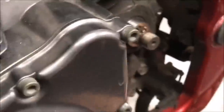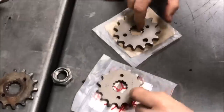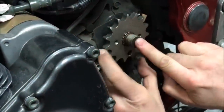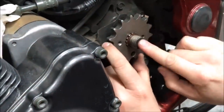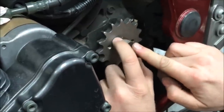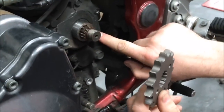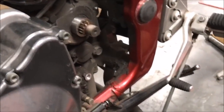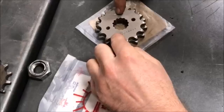Check this out - here are a couple of sprockets. They were debating on gearing, so we grabbed this one. This is brand new, mind you. Look at how bad that is - I mean that's just terrible. Even when you torque this on, it's such a loose fit it's going to hurt those splines even worse, which means hurting the transmission shaft. Your initial reaction since it's new would make you think the shaft is just horrible.